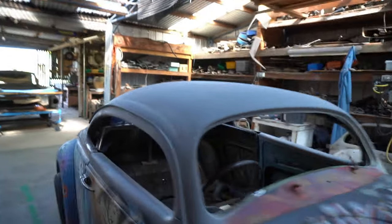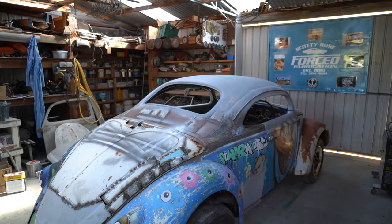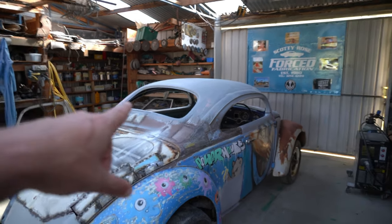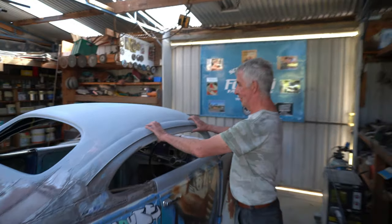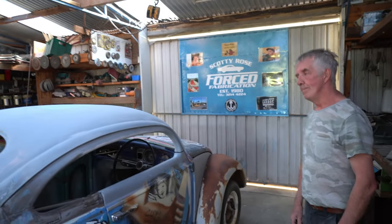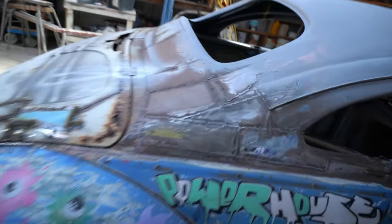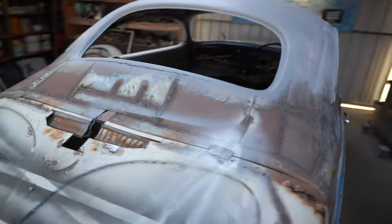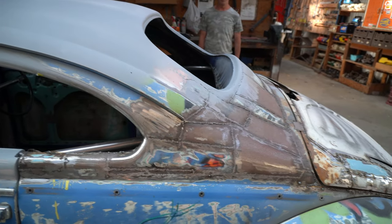The rear fenders are the same, but the roof has been moved forward about 20 inches. And that's why you get that sculptured part coming down — it's been cut and I've slaved the two pieces together. Pulling forwards, and currently going through the process of getting the boot lid to sit up and matching it all in — all the way around there, jigsawed together, hammered and moulded by hand.